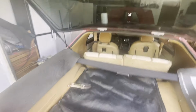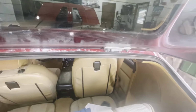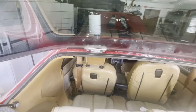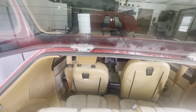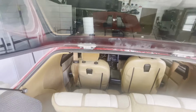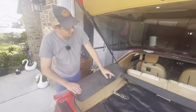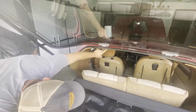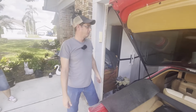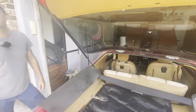All right, so we're going to go ahead and get those 2 bolts off on each side. Maybe take some channel locks, hold the nut on the other side of it, see if we can get this open with a 13 millimeter, I believe. If you wanted to try what you were thinking, do you want to just pop off the 2 on the body itself? Oh yeah, and just keep them on that, and we can lift it off. Take the whole thing off, set it on the table. Yeah, so we don't scratch the car or nothing over here on this side when we try to get those caps off. Yeah, that sounds good.